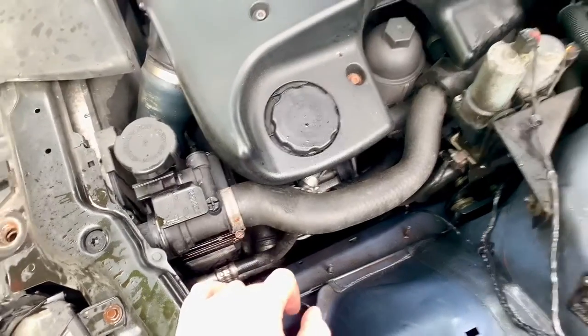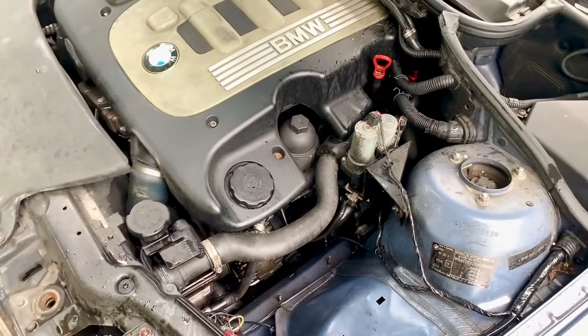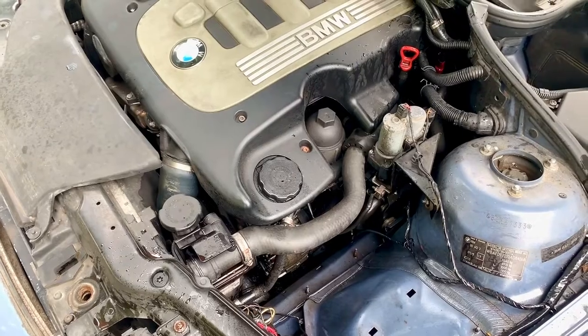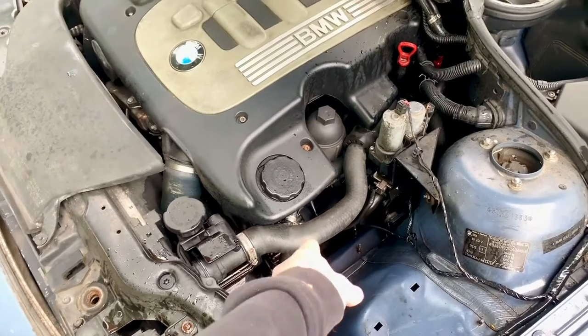What I'm going to do at the same time is drain all the coolant off. This has got red coolant in it and it's always had red coolant in it since I've had it - that isn't right, it's meant to have blue coolant in it. So I need to get some of that. First of all I need to get a new pipe.